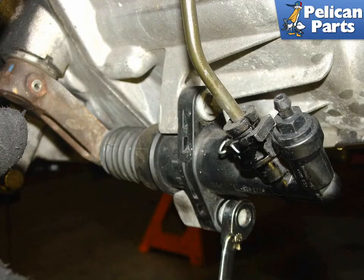Now remove the steering wheel puller from the clutch slave cylinder. As you remove the puller, the piston will move outward, which will also draw more fluid into the cylinder. Check the reservoir level and add fluid as needed. The end of the clutch cylinder piston has a domed end which fits into the throw out arm coming out of the transmission. Carefully fit the slave cylinder into the mounting bracket on the transmission and make sure the dome end fits into the dish end on the arm. Once in place, thread the mounting bolts back in and torque to spec.